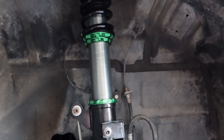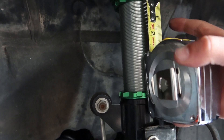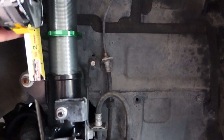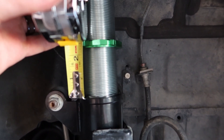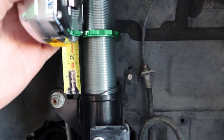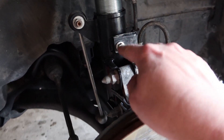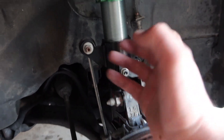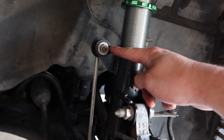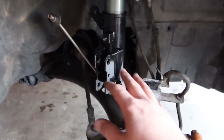I said I wanted to drop it by three inches so I'm gonna be going up quite a bit. I'm gonna go from the bottom of this locking feature to about right here. We're gonna raise it by three inches, so I'll come down here from the bottom and measure up to three inches. That's about three inches right there. Once you have that moved to where you need to be, you actually have to rotate this bottom base, so we're gonna have to remove those bolts and twist it up to that position. The tooling you'll need: 14 millimeter for the end link, 12 millimeter for the little bracket, and 19 for each of these bolts.